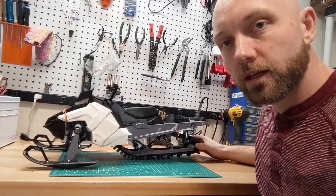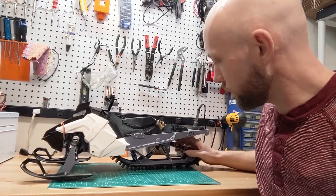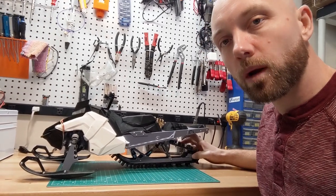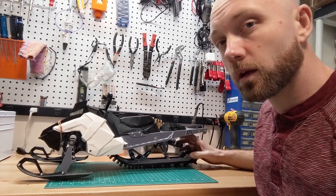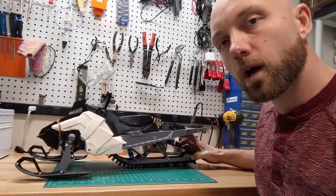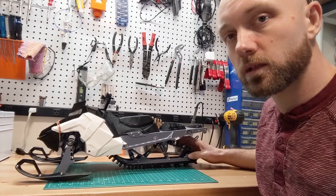The TPU track is a total win in my opinion. It is a bit more flexible, so you are going to have a bit more stretching, so it is important to have proper rollers on the back, and the stock rollers that come with the Skeeride aren't going to be quite big enough and aren't going to catch the track well enough. So one of those two mods that we were playing around with there works really well, and I'll have the names of those in the description below as well.